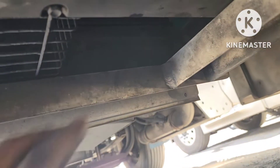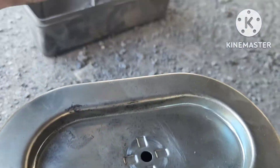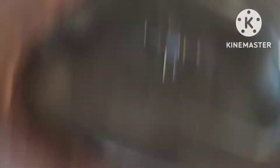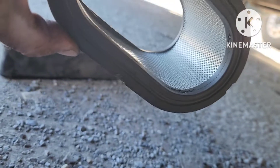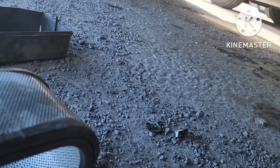Under here, this is the filter and this goes on top of it. The filter is up in this hole right here. If you reach around, you'll feel the first wing nut — take that off, pull that cover off. The second wing nut holds this on, then you take this off and pull the air filter off. She's dirty, ready to be replaced. I don't see any removable seals or any directional on there, so we're going to go ahead and drop the new one back in.